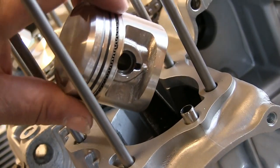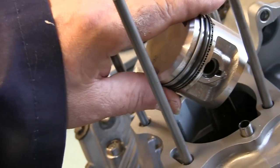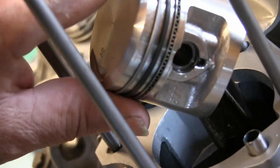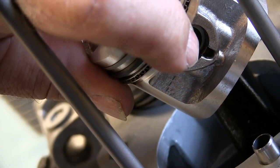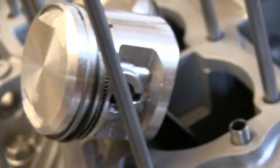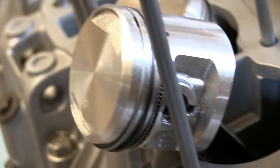She blows. I'm not sure if you can see this clearly or not, but on these pistons where the little rings go in, it says that they must go completely past the screwdriver. So get in focus there, if you can see that. It must go past this slot here, so you can't have the two ends there, and it's just a case of pushing it round. I've just used this little pointer, and it's just slid them round. They're fairly easy to do.